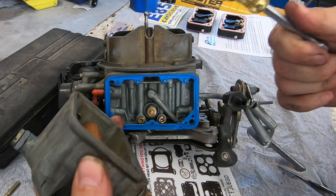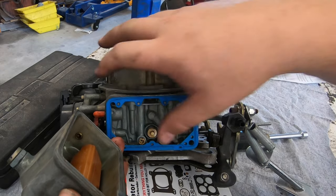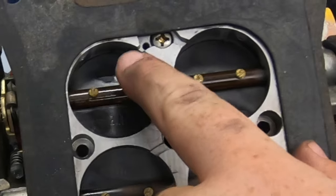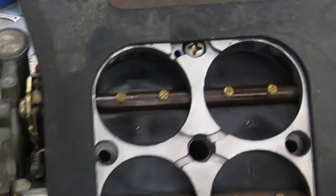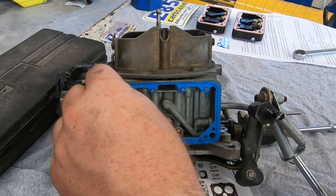Make sure you use something soft for that. You can totally do this in the vehicle, but I chose to remove it from the car to make it easier to film and because I have a supercharger I don't want to risk dropping anything into it. I also want to null out my carb by squaring up the transfer slots here to get rid of my high idle, and give the carb a general look over before I slam it back on the car and set everything back to null.